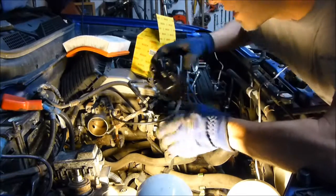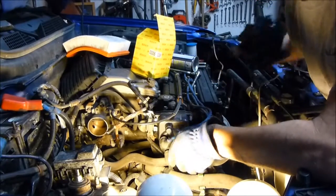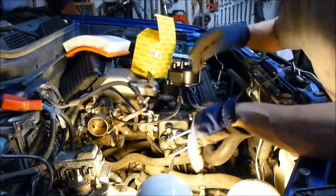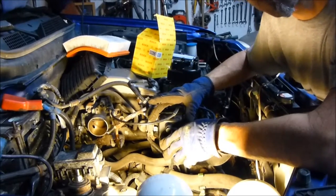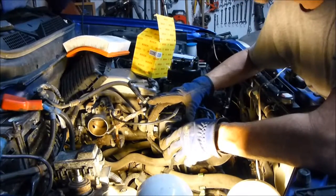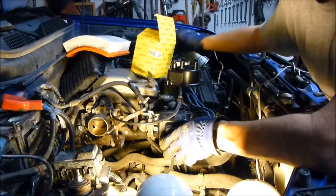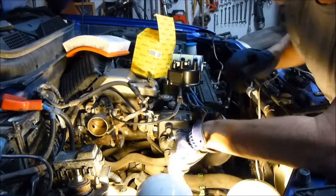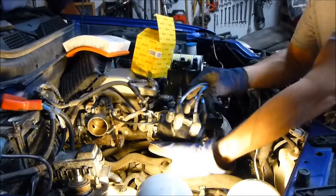I got the new one right here. When you remove the screws, be careful because the housing is aluminum and the screws are metal, so they tend to rust and seize inside. Just use any kind of penetrating oil — shoot a bit in first. I slackened all the screws and they came out nice.